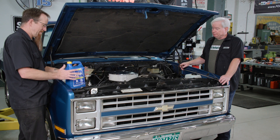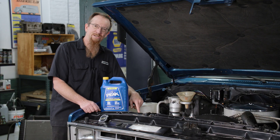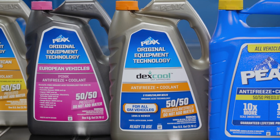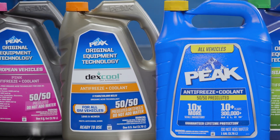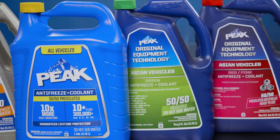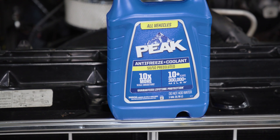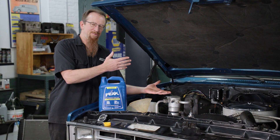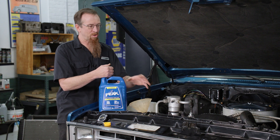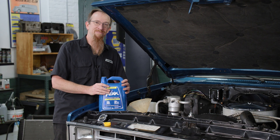All that's left is to fill it up. We'll top it up with antifreeze and run the truck and burp any air out of it. We're also going to check our transmission fluid since we disconnected the oil cooler and spilled a little bit there. You do want to be careful — nowadays there are so many different antifreezes on the market. You want to stick with just one; don't be mixing them, especially when it comes to inorganic, because that's when you get that nasty sludge that will block everything. I've got some 50-50 ethylene glycol here. The water that's in this is actually treated — it is pH neutral and mineral neutral. Distilled water, because it is completely empty of any minerals, will actually draw minerals out of the engine and the cooling system. So you're actually better off buying water.